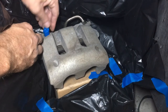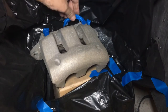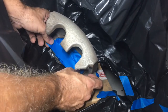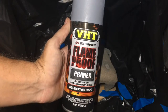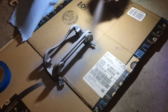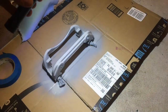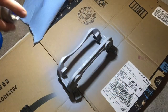The last step is to wipe down the parts using rubbing alcohol to make sure there's no loose dust or debris. Tape any caliper parts that you don't want painted, especially any of the rubber pieces or the brake fluid line. Take extra care when covering up the rubber parts — my caliper has two pistons but yours may have anywhere from one to four. Calipers get very hot from brake pad friction, so you need a primer that will withstand heat. I'm using VHT Flame Proof — I'll put a link in the description. Start off by spraying a light coat; full coverage at this point isn't necessary. The purpose of this coat is to provide a surface for subsequent coats to stick to. Do this for both the mounting bracket and the caliper, then wait 10 to 15 minutes and you're ready for coat number two.